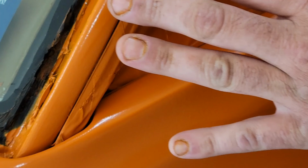The more time you take now, the more time you're going to have driving. Or you're just going to have an ugly spot in your paint job if you just don't really care. You see, I didn't tape very, very well. I got some of the chrome. I think that chrome might become body color anyway, because it's got more scrapes and pits and cracks in it. I'm pretty sure it's aluminum. Anyway, just take your time, guys. And also, try not to get the tape onto your fresh paint. I'm not saying to pull it, but it could be a good risk, especially if you're using rust paint, because this stuff usually takes a good 7 days to fully cure. I did put automotive hardener into it. After 48 hours, they say it's cured, but I still go by the properties of rust paint. It takes a long time to dry, but we'll be right back.